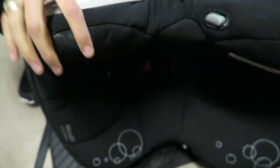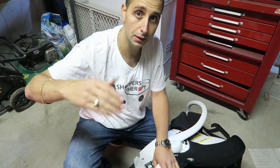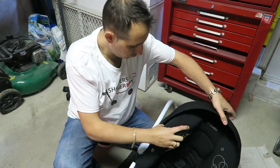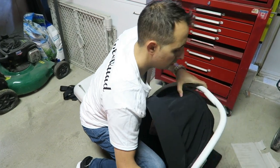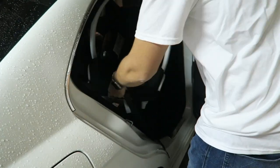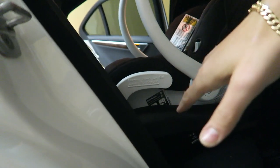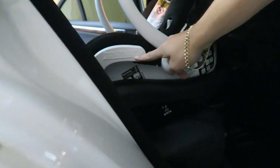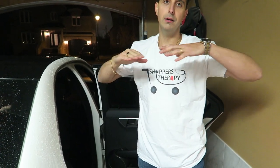There's a level indicator here - level to the ground. So when you install your bucket seat base, this indicator tells you if the seat is properly leveled. If your seat is extremely inclined, you use that adjuster I showed you earlier to make sure it's level. Doesn't need to be perfect - don't get your level out and start panicking. Only if your bucket seat is significantly tilted one way compared to the ground should you use that underneath adjuster to make it more level.